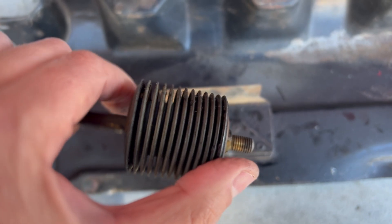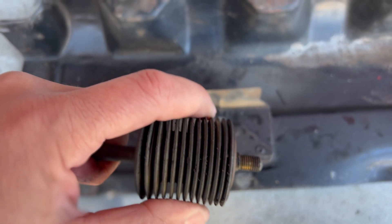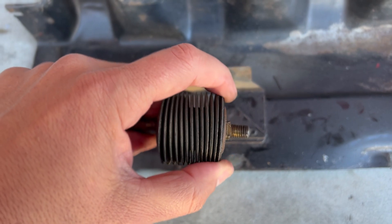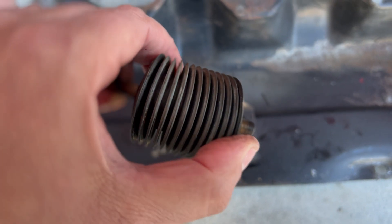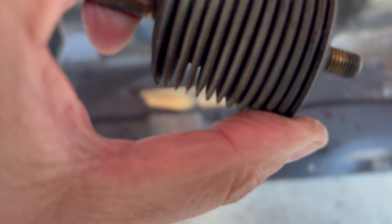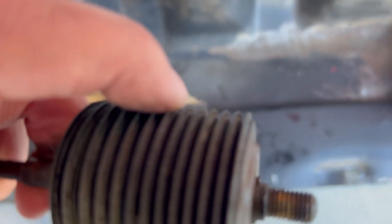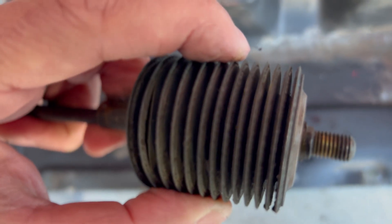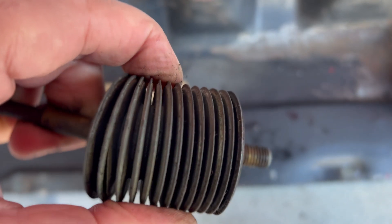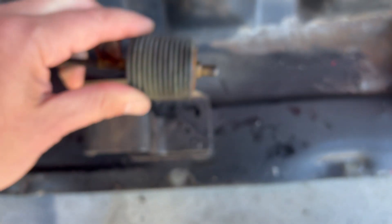Now, this thing is normally open with nothing in it — it's kind of just like a spring. What happens is the bellows get stuck wide open, and that's a sure sign the refrigerant has leaked out. I was looking for a leak and sure enough, there it is — you can actually see multiple cracks right there. Refrigerant leaked out and this thing went open. You can see it's just corroded. It's old.